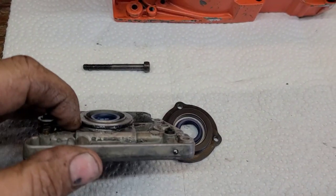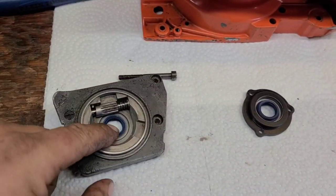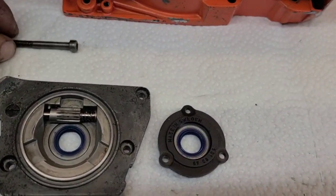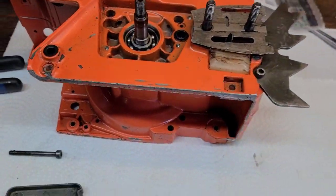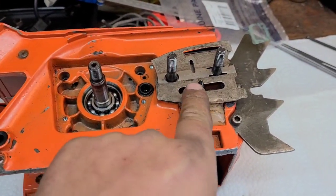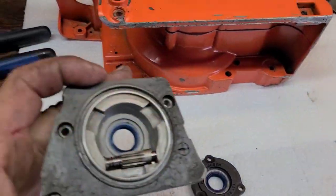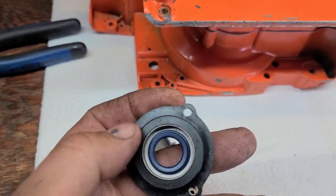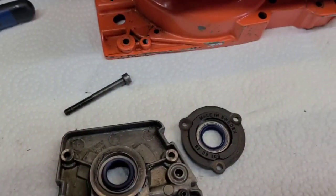See that little o-ring here — all the way around both sides. This is behind the flywheel and this is your oil pump. You have a crank seal on both sides, but you also have these little o-rings. Nine times out of ten when you have an air leak on one of these saws, it's usually these o-rings deteriorated. These are available only from Husqvarna. I put grease on them before I install them. We're just assembling Buckin's bottom end — putting the guide plate on, chain adjuster, bottom crank case bolt for the dog. I just thought I'd show you guys that these things leak all the time. In a pinch you can put silicone around and mount it in the case, but a lot of people don't know there are seals there.